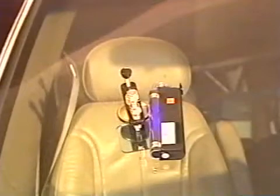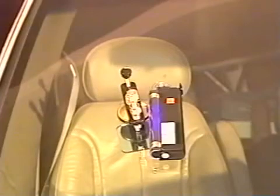Once the repair is completely filled, the repair must remain set up under pressure for a minimum of 10 minutes or longer to allow resin to seep into the repair well. During this time, use a UV lamp to harden the exposed part of your repair or use direct sunlight.